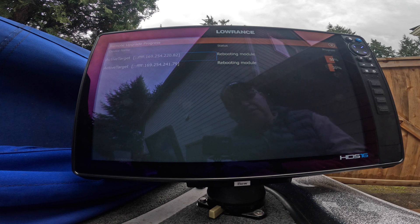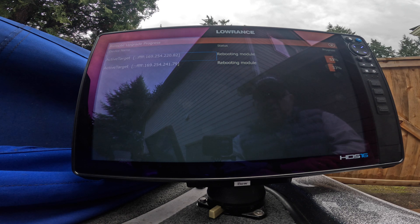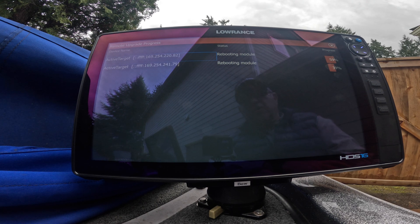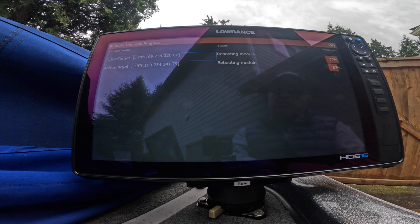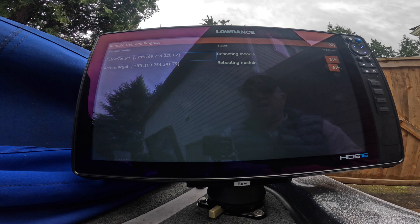This is another reason why I don't like to do this by Wi-Fi. You can update your units by Wi-Fi, and in some cases you may have to if you don't have a computer handy to download the files. But you're risking that your data will get corrupted in the process of downloading via Wi-Fi, and then it's not going to be a good clean install on your units. So I highly recommend either using a micro SD card or a USB mass storage device like I have here.